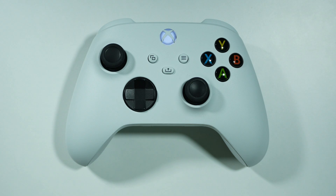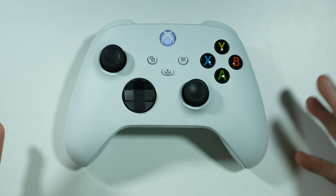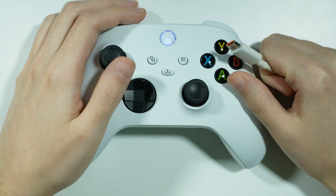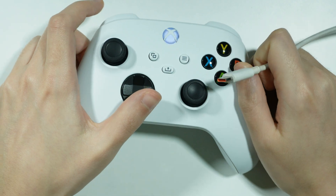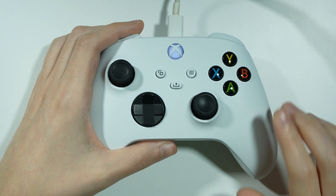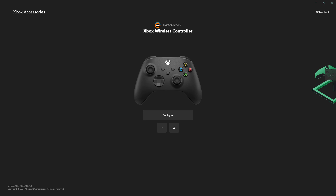On Windows you want to go to the Bluetooth settings and pair the controller again. The next thing you can do is update the software on your controller. To do that you need to connect to your Xbox console or PC — you might need to use a USB cable to perform the update. On PC we have the Xbox Accessories app which can be downloaded from the Microsoft Store, and this is where we can update the controller.